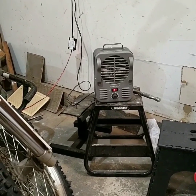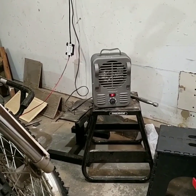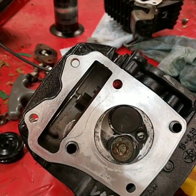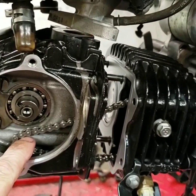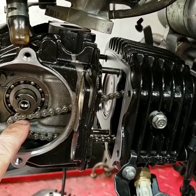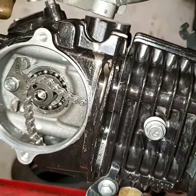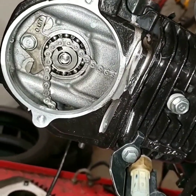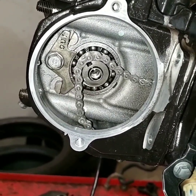It's been a while since I did a sponsorship — the only thing I can really come up with right now is the heater in my garage, so it's my sponsor today. I'm going to put this head gasket on here and put this head on the Grom. I've got the head on and the head gasket in place, and I'm just going to slide it down into place — I'm not going to try to film this. I've got my timing mark and I'm still at TDC. I slid this bad boy down on here and I'm going to get it secured and torqued down, then work on timing, which I think I have pretty close.